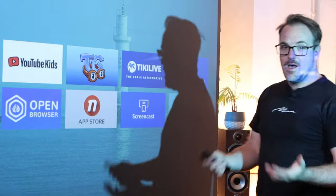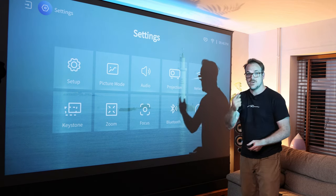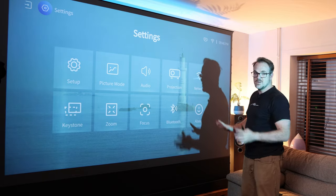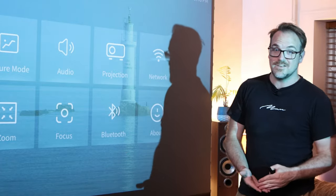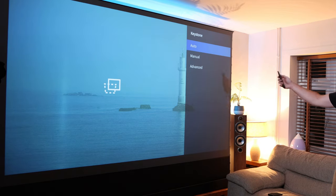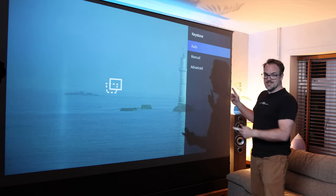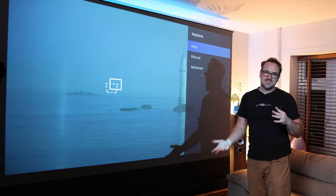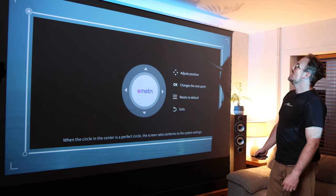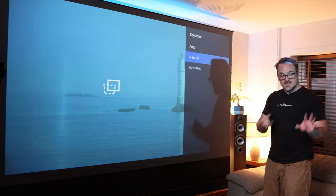So the first segment of this video I'm going to show you how to set up this projector and what features it has. Normally when you first set up a projector, there are two main important things to deal with: keystone correction, which makes sure the screen is essentially a square or oblong, and focusing, to make sure the screen is not blurry. This projector advertises automatic keystone correction and automatic focusing. Going into keystone correction and pressing automatic — what it has done is automatically broken the keystone correction, it's no longer straight on my screen. So automatic keystone: not great. But the manual keystone correction is great, because it gives you the ability to very easily get the screen as straight as it needs to be.